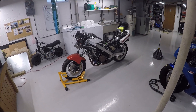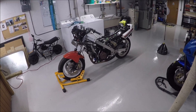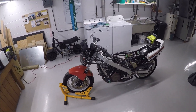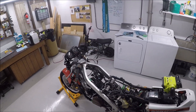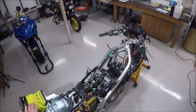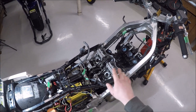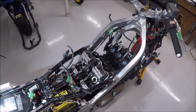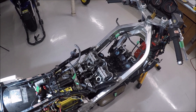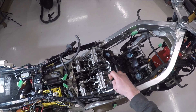I'm still working on this 1986 Honda VFR 700F and despite all the other issues I found along the way, I need to find out if this thing is actually worth restoring by opening up the valve tray, checking the clearances, checking the state of the cam lobes. What I found is that everything looks really good — and it's very exciting to see the gear-driven cams inside. This was actually much easier to set the valve clearances on versus my VF 500F.